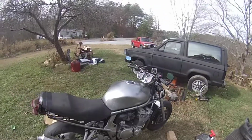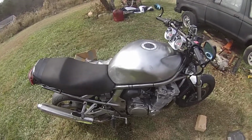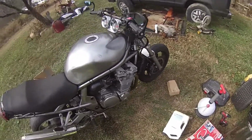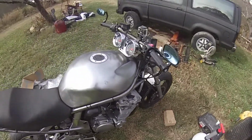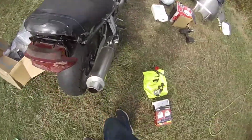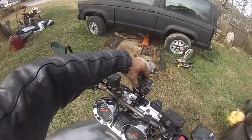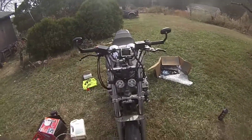All right, went through and scuffed up my frictions, or steels, I'm sorry, on the clutch pack, and then sucked the gas out of the top of the crankcase and put the fresh oil back in it and fired it up, and it sounds nice and no problems, no ticky-tappy, didn't get too damn loose. And also went ahead and mounted a camera right there just to see.